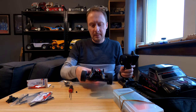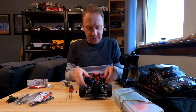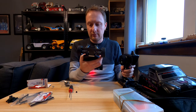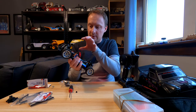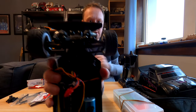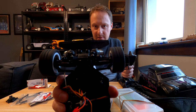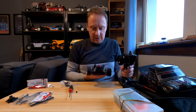There's a lot of... I was going to say wheel wobble, because that's what it looks like. But it isn't quite wheel wobble. It's transferring through the steering arms, and the whole steering rack is moving back and forward ever so slightly from the centrifugal force. It's almost as if the wheels or the tires are imbalanced, and it's throwing everything else out a little bit. Have a look at that steering arm, for example. You see that? I don't know if you can, but I don't know if that's going to be enough, especially if it's on the ground, you know.